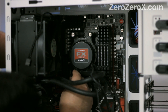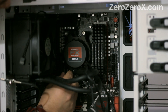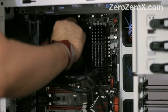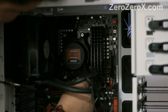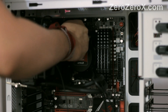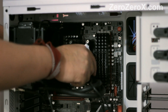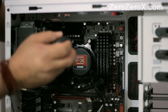Now that you put the pump, you have to screw each screw with the plastic head a little bit — do it one at a time, align them correctly with the back plate. Depending on your motherboard, screw them one by one carefully and patiently. It will get to a point where you need to use a screwdriver to put some pressure on the pump so it can be pressed against the processor.